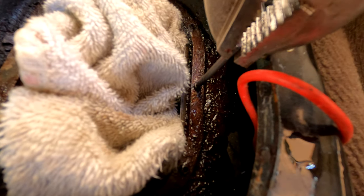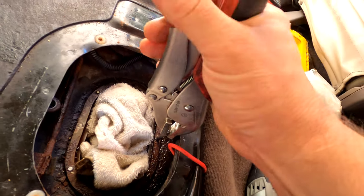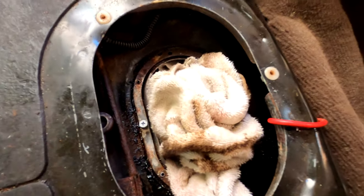The issue is these aren't even moving. I don't want to put too much torque and snap the extractor — they're really locked in there. I don't want to snap the extractor, break anything, or drill them out and tap them. Maybe I'll go a little bigger on the drill bit until the bolt disintegrates in the threads and I can re-tap and clean them out. Freeze spray didn't do much and I don't have liquid nitrogen. I'll let it soak overnight and see what happens.